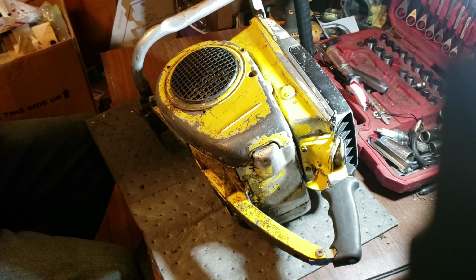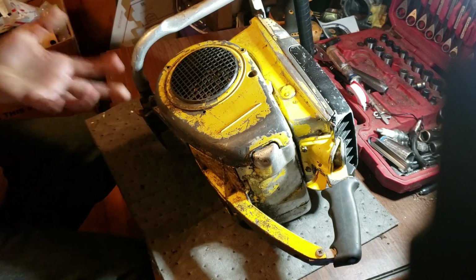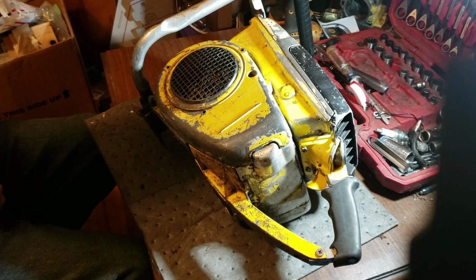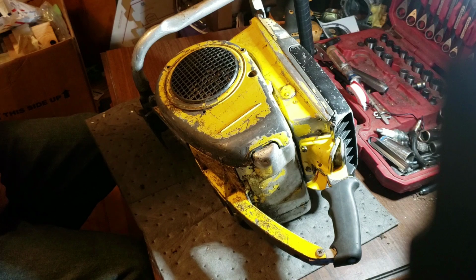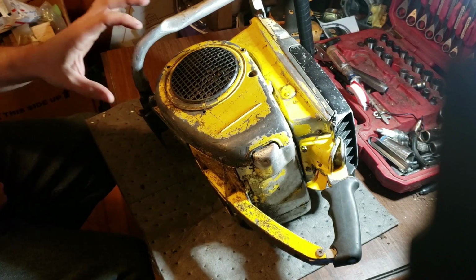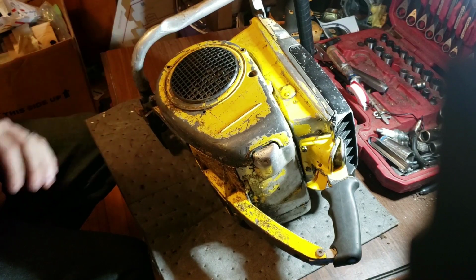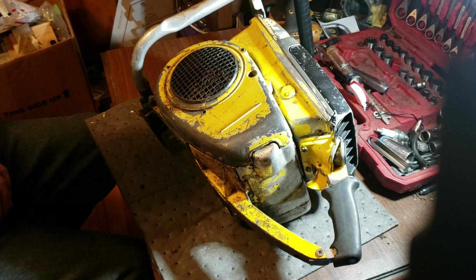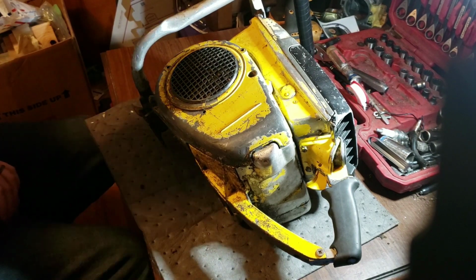That's kind of what I'm feeling, but also we got to take this side cover completely off of the block and replace that seal. Look at the points and see if they're wet at all, because what happened last time, it ran great actually for 20 seconds. I revved it up in that 20 seconds, and right afterwards it started hitting and missing. The ignition just wasn't spot on like it should be. I even pulled the spark plug, I have ignition, but I don't know if it's because at higher speed it's going to be affected versus a lower.